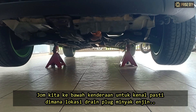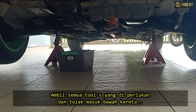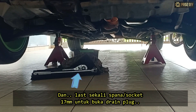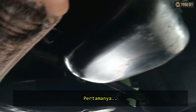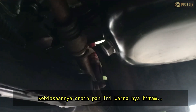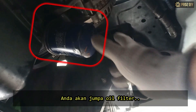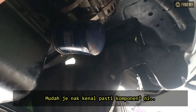Let's go under the car and find the oil drain plug. Grab your tools and slide them under your car: oil collection pan, towel to clean up spilled oil, and a 17 mm socket wrench to open the drain plug. To find the drain plug, first locate the drain pan. The drain pan is usually black in color and has a bolt coming out. In front of the drain pan you can see the oil filter — pretty easy to locate both the drain plug and the oil filter.